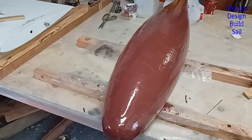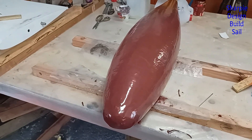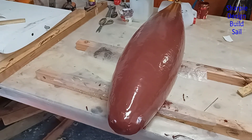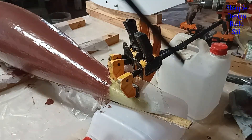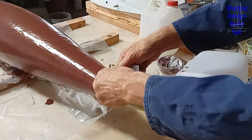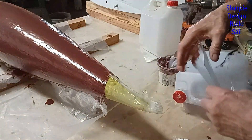The mission today is to wash off the blush — you just use water for that. I put a little bit of detergent in, roll it over, trim off the fiberglass and put two lovely layers of double bias on the top side. Trying to do it all in one go turned out to be quite tricky. Hopefully this plastic will peel off and leave a very nice result.